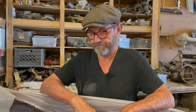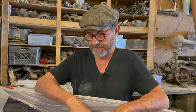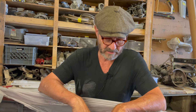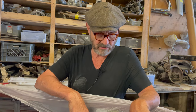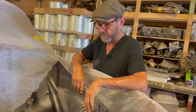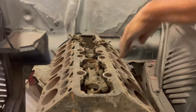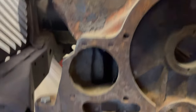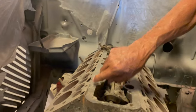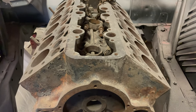Part of it is just a preference thing, but clearly if there are some parts that aren't even available at all — and if you've been doing this for many years, you know your supply line — if certain parts just don't exist, you're at the point where you're fabricating something to make it work. We're fabricating a lot of parts. We talked about the water diverters that go up inside the engine — they're not available anymore; they've all rotted or been pulled out. So we're going to recreate those, probably out of stainless so they last longer.